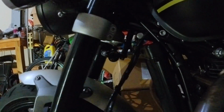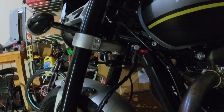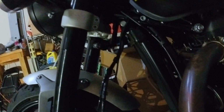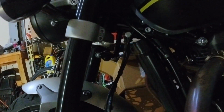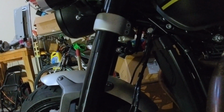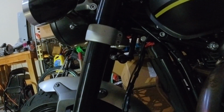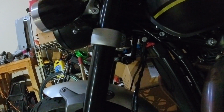So what does a steering damper do, Riley? It dampers the steering? Sure, in a literal sense, that is exactly what it does. So you see how you have suspension. You've got your forks. There's springs in here. There's valves. And what it does is it makes it controlled. So when you hit a bump, it doesn't bottom out and it doesn't rattle your teeth out, right? It absorbs the bumps and makes the ride smooth. Your forks do that in an up and down fashion, same as the shocks out back. They control the bike in an up and down fashion.